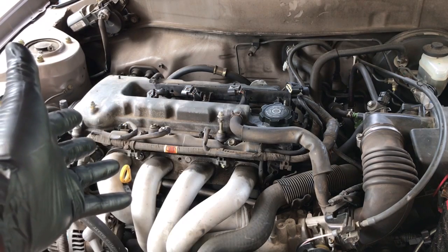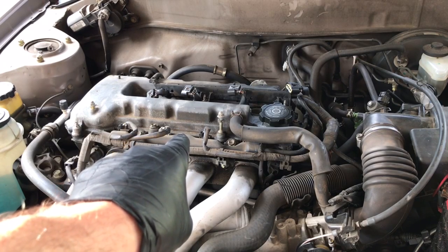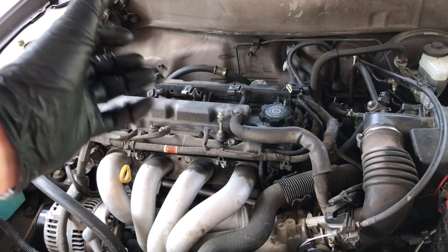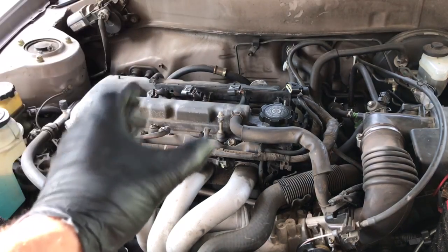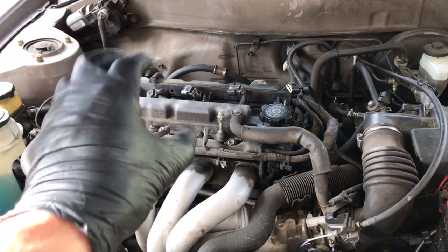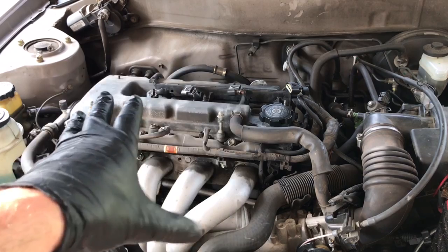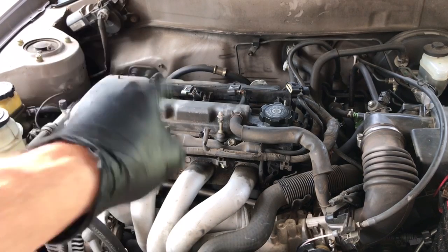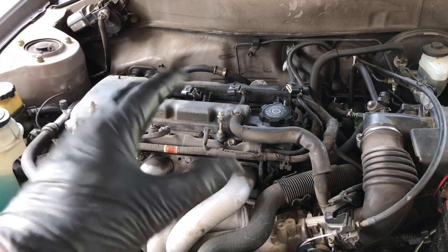Maybe you have some more suggestions, but we might be able to come up with something to add to cylinder numbers two and three that could soak in that single cylinder. We could focus our efforts into dissolving the crud around the rings in that single cylinder, the carbon, the gunk, whatever it is that makes these rings stick. Maybe we could find something we can pour in there and let it soak, do it a few times, do it hot, cold, whatever, I don't know.